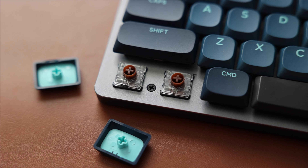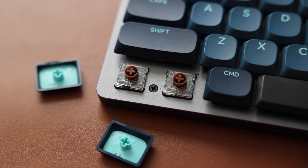But this is a mechanical keyboard — can't you just swap out the switches for ones you like better, and still keep all the convenience features? Maybe technically, but not really, because this is not a hot-swappable keyboard and it's not really meant to be taken apart. There are some screws — you can unscrew it, take it apart, and use spudgers to tear off the outer shell — but you have to solder to remove the old switches and put new ones in. You can do it, but it's a significant amount of work, and I just don't know if the audience for this keyboard is going to be into that sort of project.